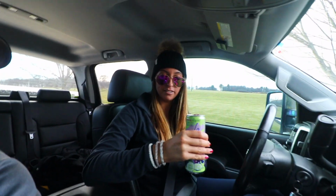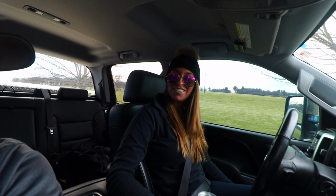So have you ever done a burnout? No. Have you ever been in a vehicle that has done a burnout? No. Do you know what a burnout is? When you make the tires spin? Yes, and we don't move. To do a burnout, you're going to place one foot on the brake, one on the gas. You're going to have the brake depressed quite a bit. You're going to give it gas, and you're going to feel it start chugging. It's going to start making some power, and then the tires will spin. At that point, you can gently let up on the brakes to get more wheel speed with the throttle.